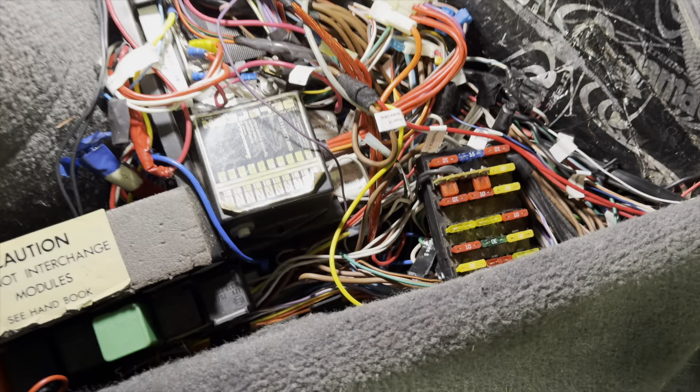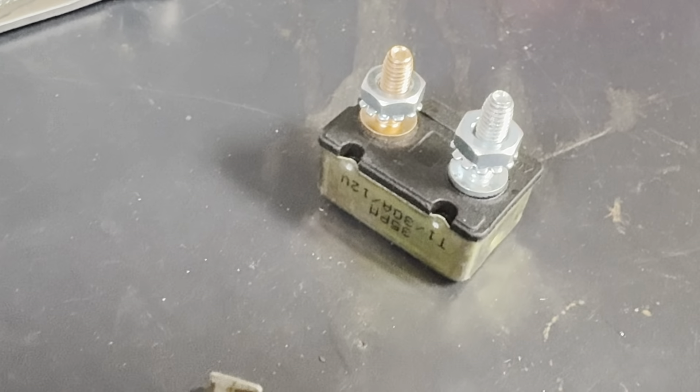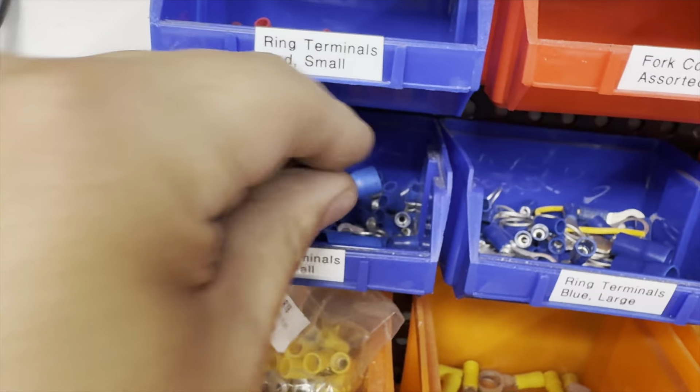The scoop was meant to supplement the cabin blower, not replace it. But my blower had an intermittent problem where it would just stop running for no obvious reason. Because of the high current draw, the blower circuit is protected by a 25-amp breaker instead of a fuse, and this seems to be right at the edge of what the blower can draw. It was just overheating and cutting off, then the breaker would reset. It's commonly updated to a 30-amp breaker, so that's what I did. I cut the old connectors off and crimped on ring terminals. It seems to have fixed the problem — the blower worked perfectly for the entire trip.